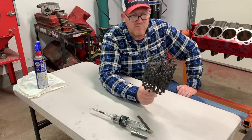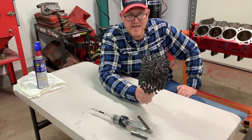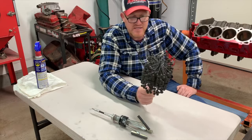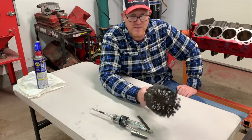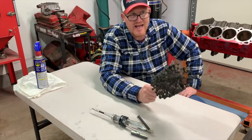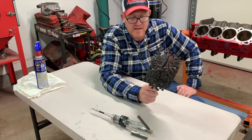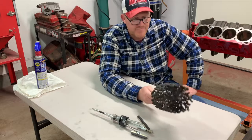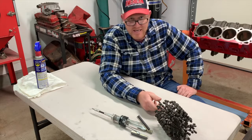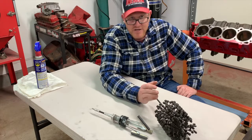Well, these things became much more prolific in, like, the age of drag racing. So let's say the 50s through the 70s, where you already had an engine with a fresh bore on it. What you were doing is you're re-ringing it to get every ounce of power that you could in between rounds, especially like in the top fuel classes, where the engine might only have to run for 20 seconds, 30 seconds. By the time you get to the end of the track, it might have burned a hole in a piston. You're going to replace the piston.